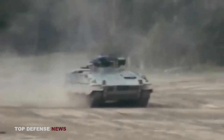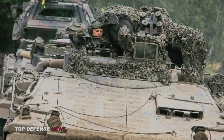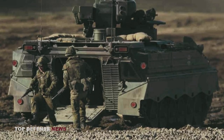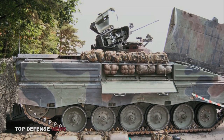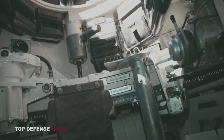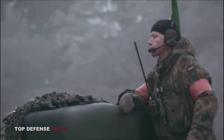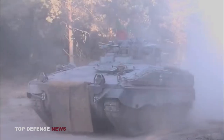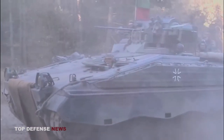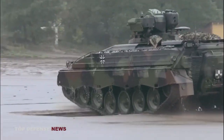The Marder 1A3's overall layout is similar to that of the previous model, with the driver's seat on the left side of the front hull, the engine compartment to the right of the driver, a two-man turret mounted in the front, and the troop compartment in the rear. Modifications include an improved ammunition feed, new-design seats, increased knee room, and a longer passage between the commander's and gunner's seats. The all-welded steel hull protects the crew from small arms fire and shell fragments, and the front is fully protected against 20mm armor-piercing discarding sabot (APDS) rounds. The Marder 1A3 is also protected from 30mm cannon shells by a brand-new multi-layer armor package.